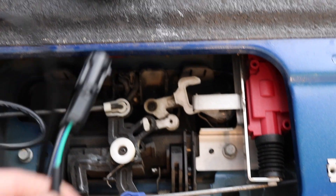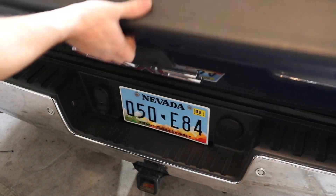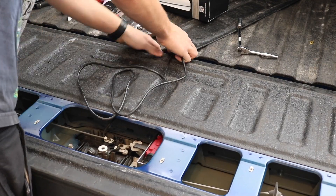There's a little hole from the tailgate to the bed right here. You can see there's already a wire running through it — that's for my backup camera. We're going to run this wire down through the tailgate, out the hole on this side, and into the hole of the bed. Here is the wire ran underneath the truck.